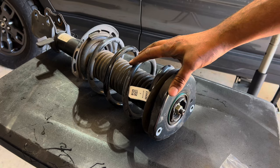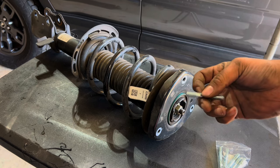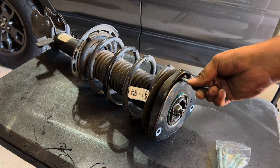I'll give you a quick walkthrough on how to install the studs into the front shock assembly. The front will be done in probably about 30 to 45 minutes. Here's the assembly — you're going to get the bag of six studs. The studs are different because they have a long end and a short end. Take the supplied thread locker and apply it to the short end, then thread it into the top hat.